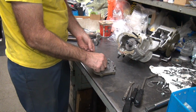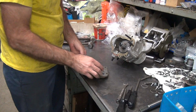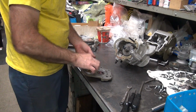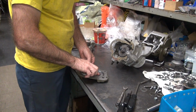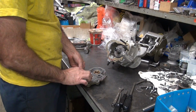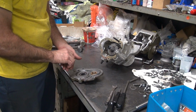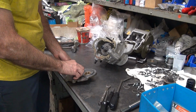And there's no way I could have put that washer in there because it was pressed in pretty good. So the washer stretched to go on over the collar, huh? No, it's compressed into the collar. Oh. It's inside the bushing. It's not on the outside. It's on the inside. If I didn't deburr the top edge, it would shear the metal off and cut the thing.